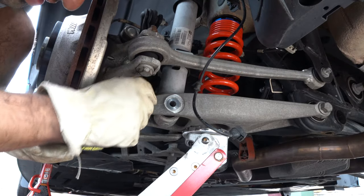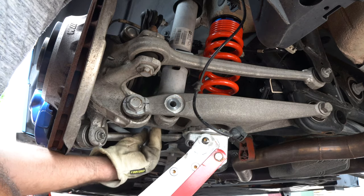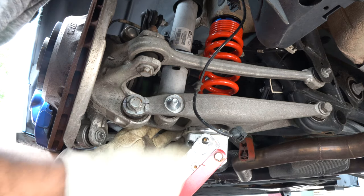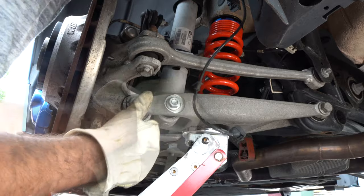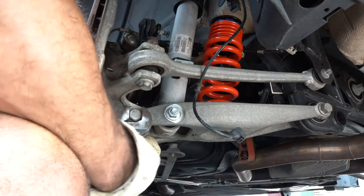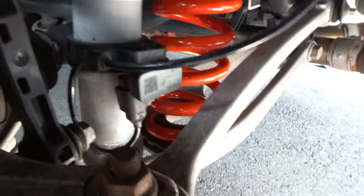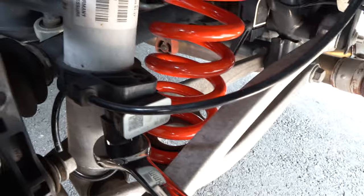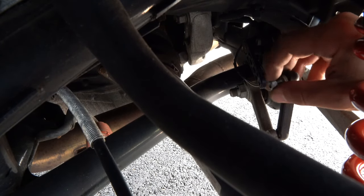You might have to do some wiggling but eventually things will go in place. The alignment bolt went in, and now we grab a new strut bolt and put it in place — much easier when you have a jack underneath. We can torque everything back to spec. Now that everything's tight we can reconnect the strut sensor. I had a lot of issues getting this plug to connect — then I grabbed the wrench and pried it up until it clicked, and it worked like a charm. The last bit is reinstalling the leveling sensor and we should be good to go.